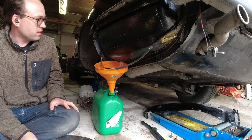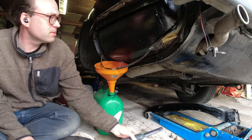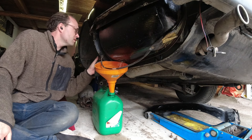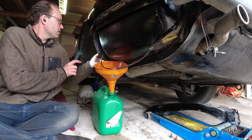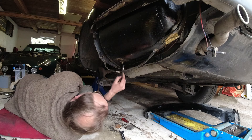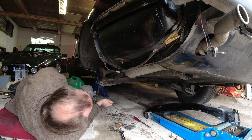I want to investigate and find this leak, and I think it's a good idea to replace the other hose too. I'm going to check if I have a bit of hose that fits — you can see it goes in there and over there. There are the return valves in here. There's a fitting right here which is the fuel return, and that goes to a pipe that goes up to the top of the tank — that's pretty much where it returns.